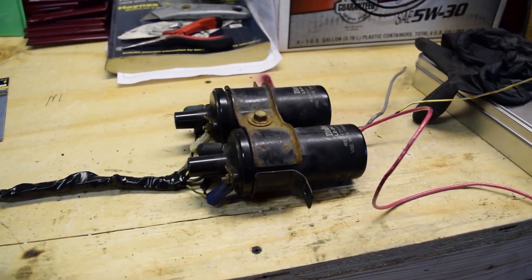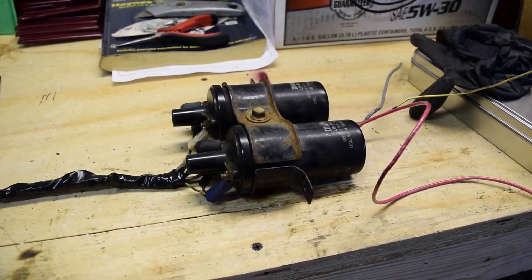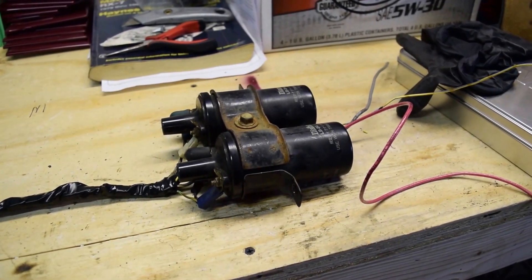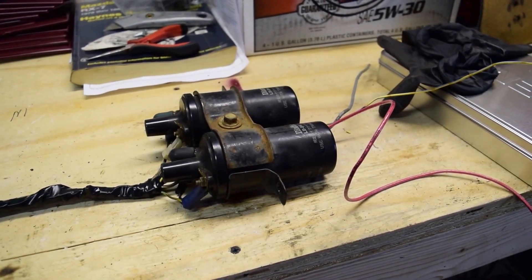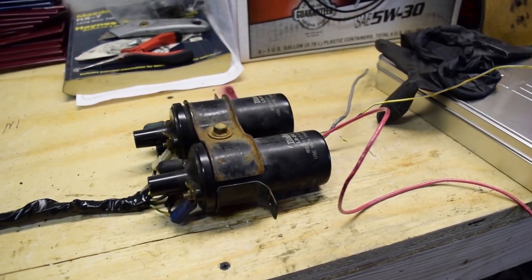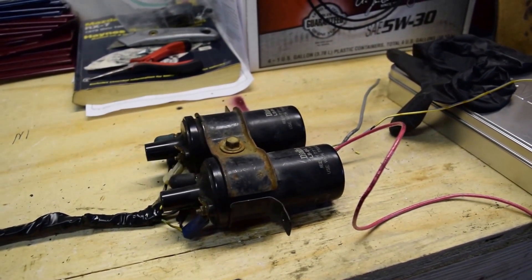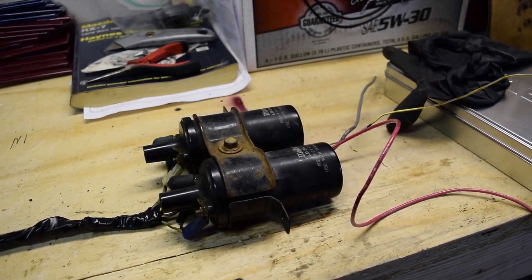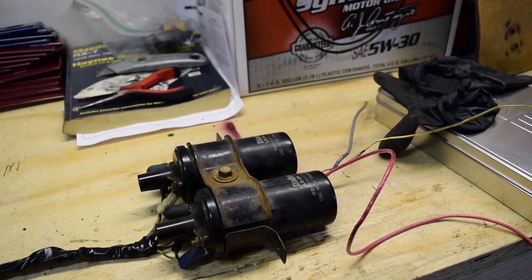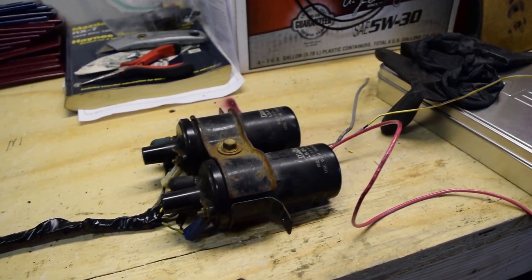Austin back here at Freeman Rotary. I'm just going to show you the simple 12A ignition wiring system that I'm going to be running in this car. With a carbureted setup, it's a lot easier to run an ignition system because you don't need to adjust timing as much besides with the distributor. You don't need to run a lot of electronic sensors and switches and the necessary things for an ECU to be able to time it.